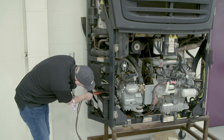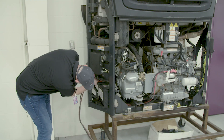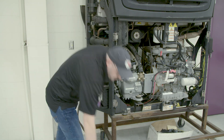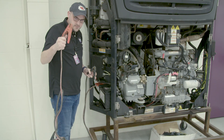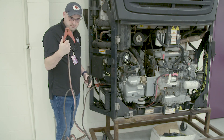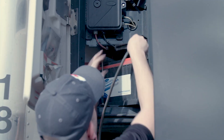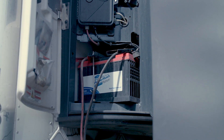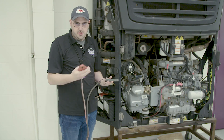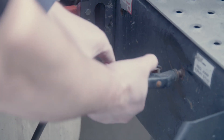It's going to be a little tight, so get it on there. Before you put your black post on, make sure your clampers on the other side of your cable are not touching each other. Then put your black post on, and go to your truck side on the back of your cab at your jumper posts and do the same thing — red clamper on your red post and black on your black.